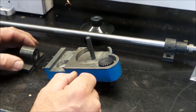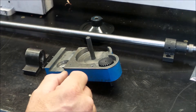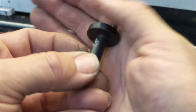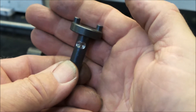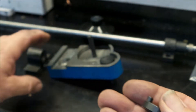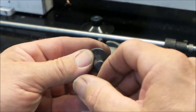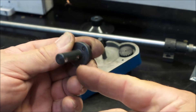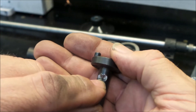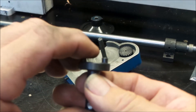Welcome back to the Aussie Shed. After a quick analysis of the half nuts and the mechanism that engages them, the problem appears to be with the shaft that connects the handle to the half nuts. These two holes here — these two detents — are for the ball bearing that sits in a spring, mounted in this hole in the side of the housing. That's what gives you your positive locking when you engage the half nut. This turns and the ball bearing is forced into one of those holes by the spring. From my analysis, these detents are drilled ridiculously too close together, and the detent position that has the half nuts closed doesn't actually fully close the half nuts.